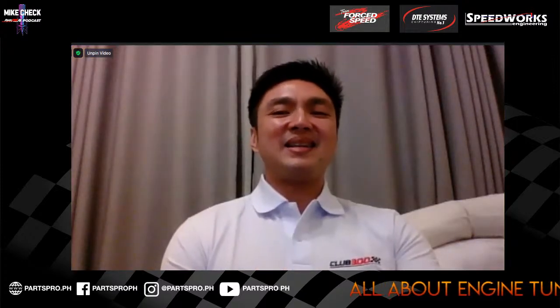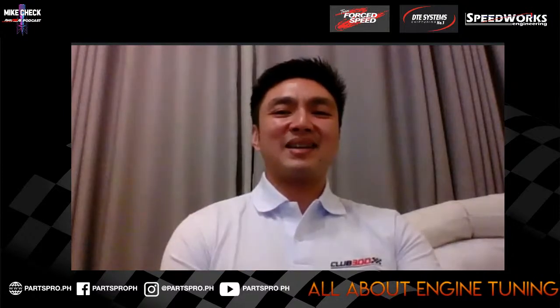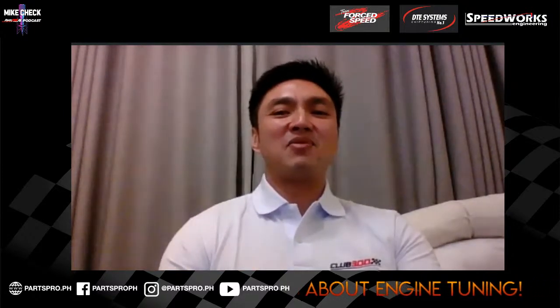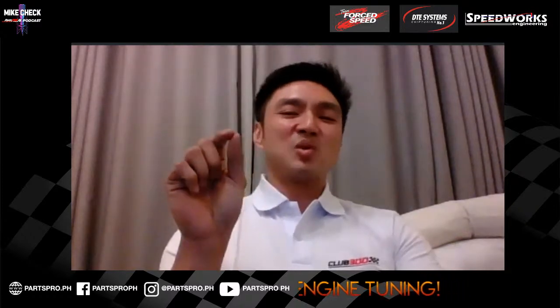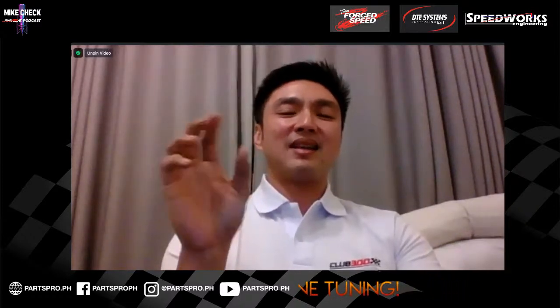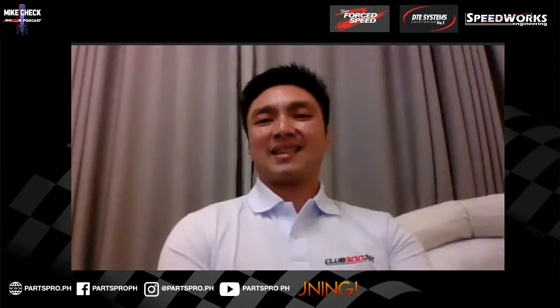Is that right, Jeff, Leo? Yeah. To be able to maximize what you install with the water meth, for example, you can add more boost and more timing. Although with the DTE, we can also turn up the settings a bit, like what we do with the JB4. The JB4s you can run in conjunction with meth. So when the car sprays meth, they can add more timing and a little more boost.